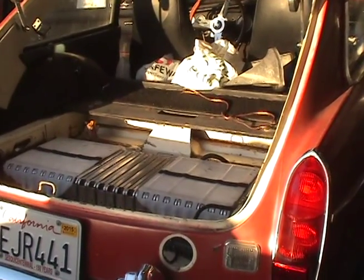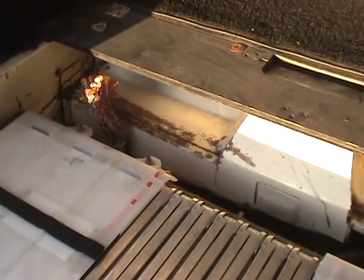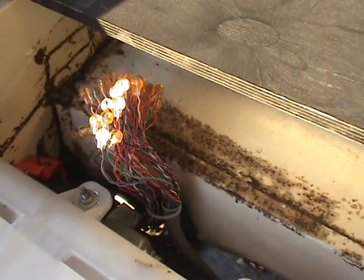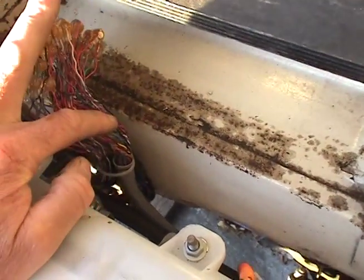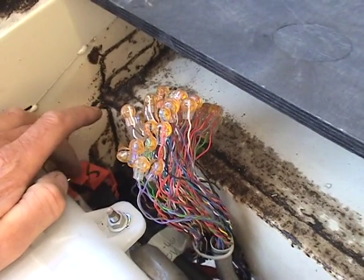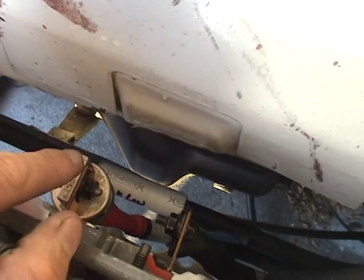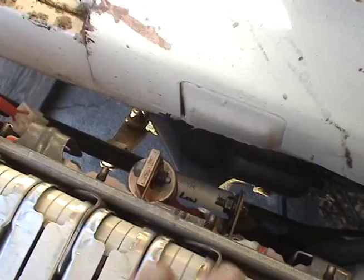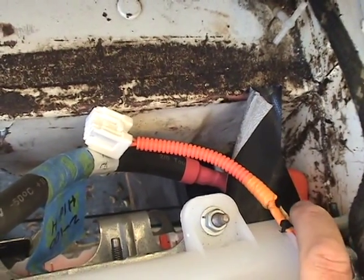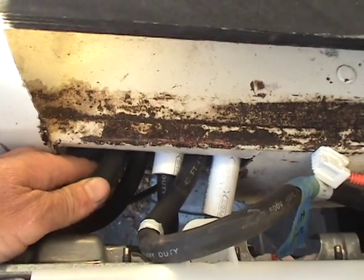Here's the back of the GT. We have half of a Nissan Leaf battery pack in here, and that bundle of wires is what we needed to connect up to get the battery management system operational — there are 49 wires here, wired up to an old SCSI cable which runs to the front of the car. This is the pack's zero volts, then the first 100-volt pack, then the second 100-volt pack. And these are the thick cables — the main current cables — that take power down to the front of the car.